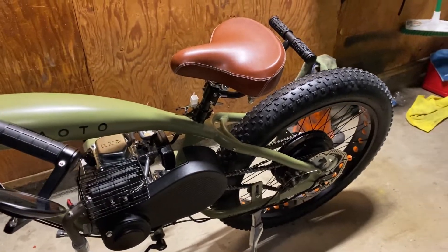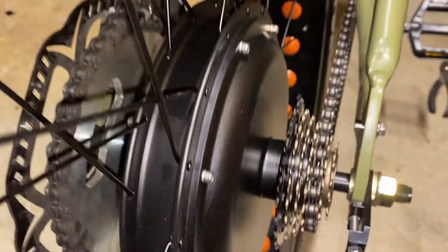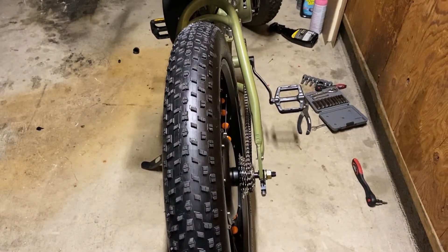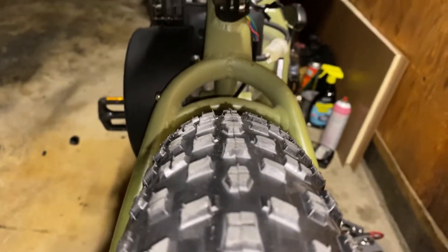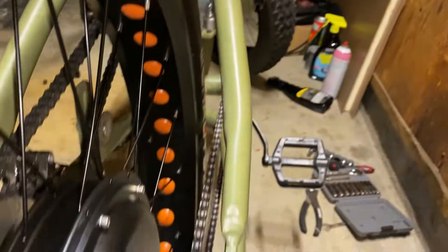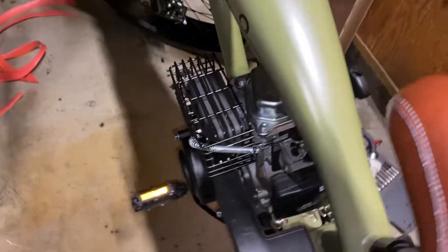The motor is on the e-hub and it's set up to the exact same chain on both sides, aligned it. I bored out holes on the existing tensioners to utilize them to center the wheel. I could probably use a couple more degrees but the wheel is tilted, so I'll have to check that with a level.